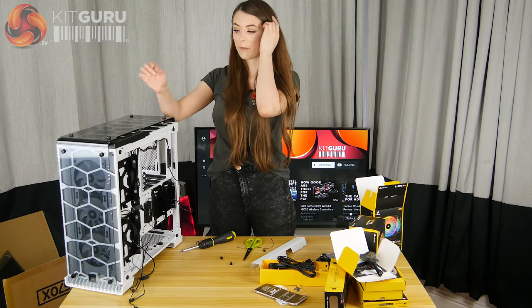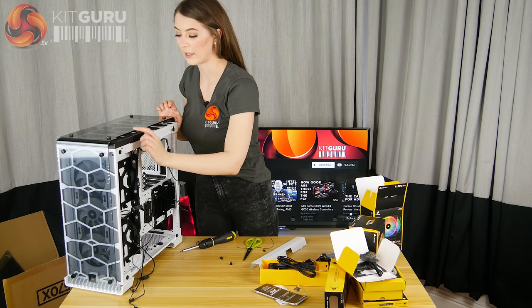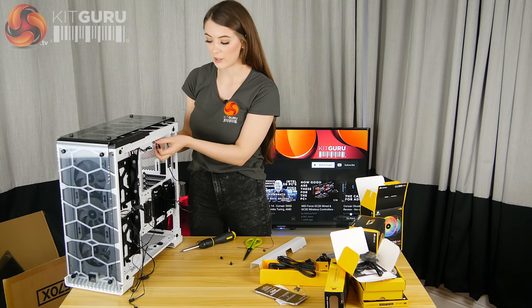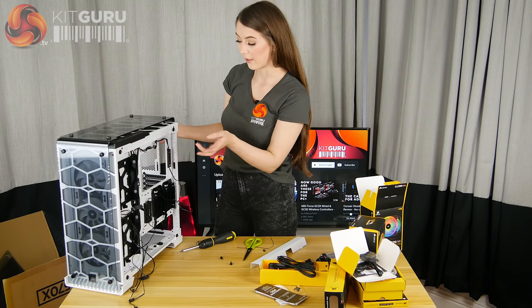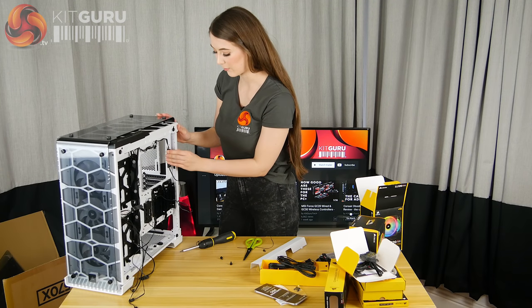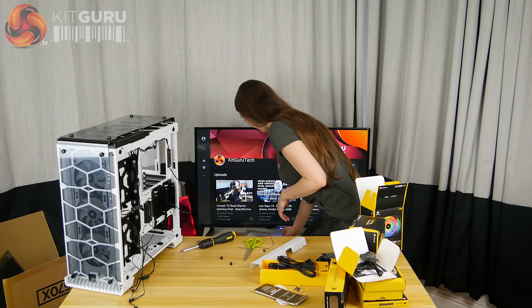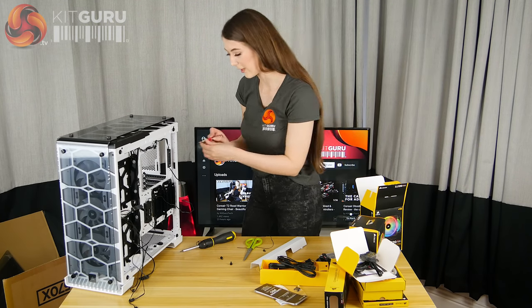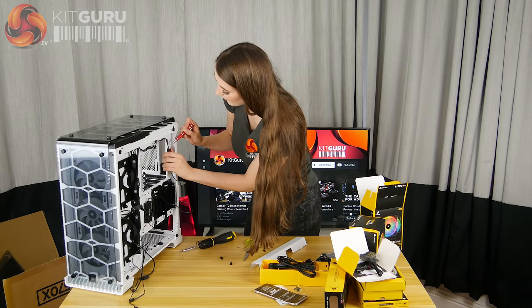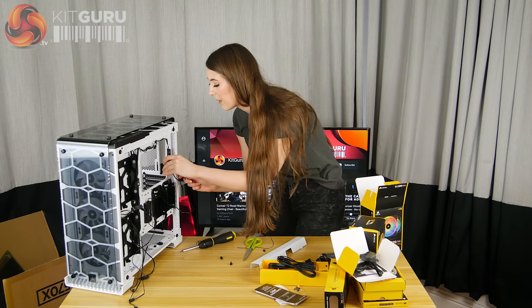Okay, so there's some fan controls on the top of the case that allow for lighting and speed and effect, which is for the SP120 fans that are in here. That's the SP120 controller, so I've just disconnected the connectors for that. And as far as I know, this is just double-sided taped on, so you just pull it off. I'm going to use a flathead screwdriver. I'm really worried about marking the paint that's underneath, but if I leave these in here, it's going to leave me less space to cable manage.